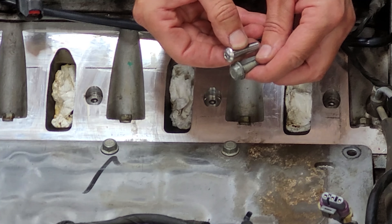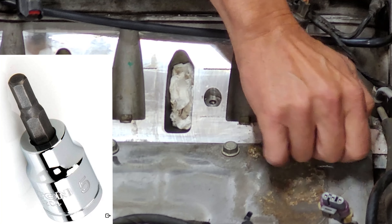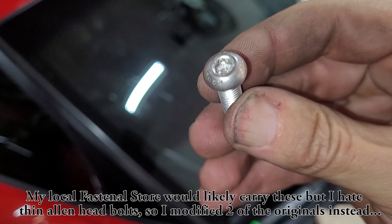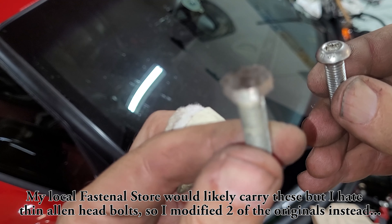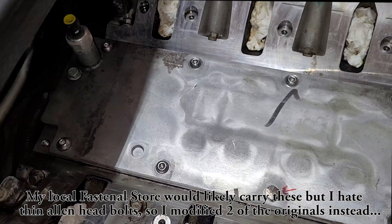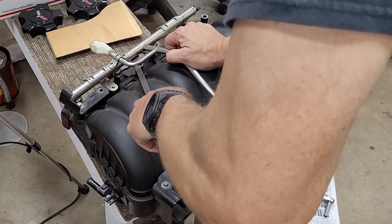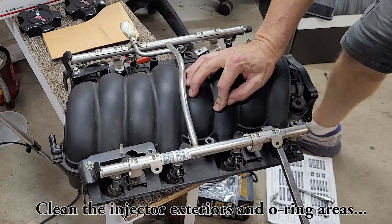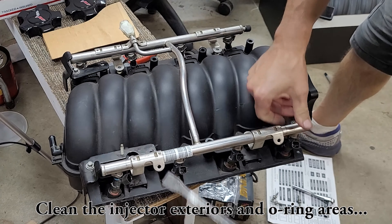Here is the old LS2 air intake that I removed and replaced last year — now I'll go ahead and remove the LS3/LS7-style air intake from the car. Now it's the throttle body's turn to be removed: disconnect the electrical connector followed by the four bolts that hold it to the intake. Then remove the EVAP line from the intake — the clip that holds it in place may break as it's very brittle; I'll include a link to new ones in the description. Next, remove the brake booster hose from the vacuum canister and plug it. Remove the clamp so it doesn't get caught on something, as you'll need to fish it through towards the intake manifold and snake it around the oil pressure sending unit when the intake manifold is being removed.